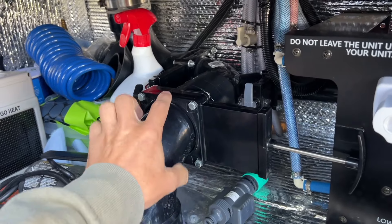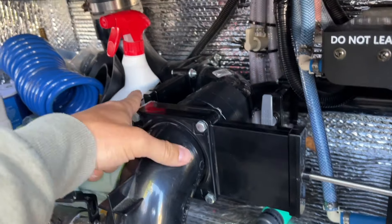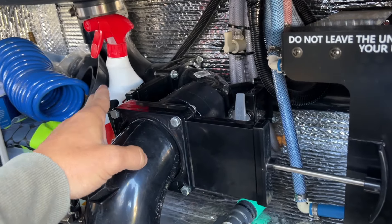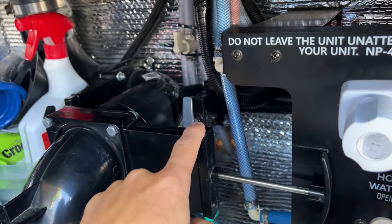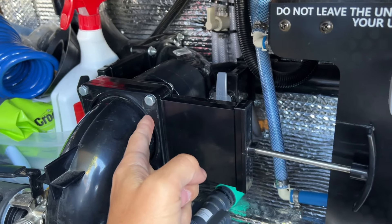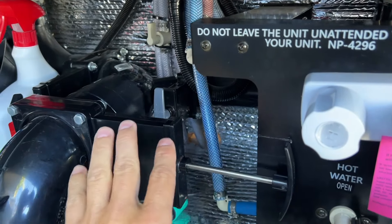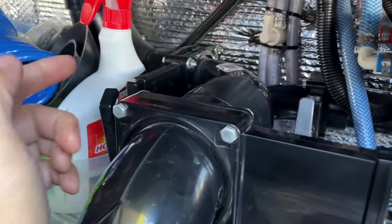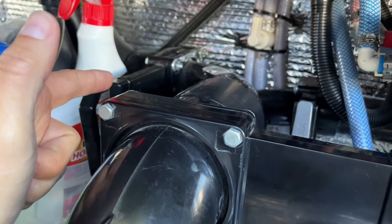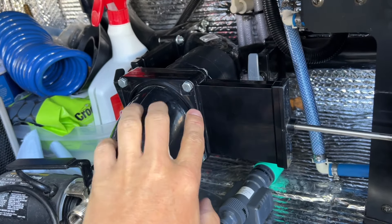This is the back of James's rig, and this is the valve we're going to replace — this is the main valve gate. This is the official black tank connection and this is the official gray tank. His black tank doesn't fill up very fast but the gray tank does, and he doesn't want to keep it open. He is going to replace this main valve with that automatic valve so he can open the gray tanks at any time from inside the vehicle.